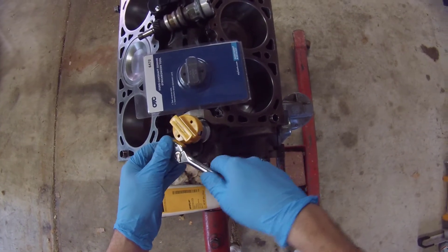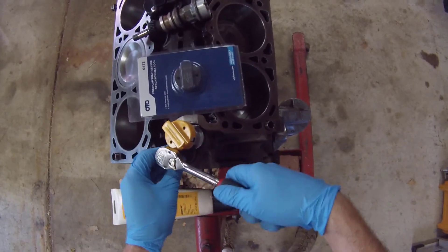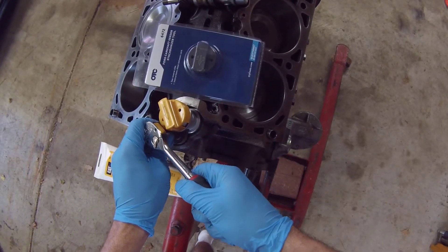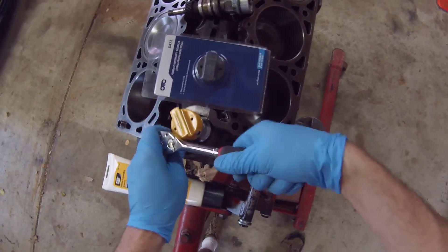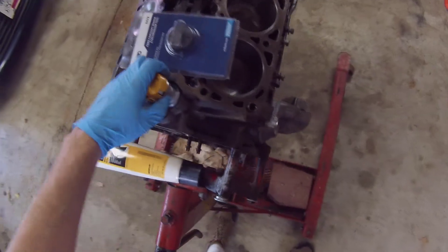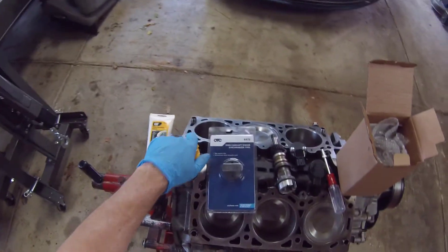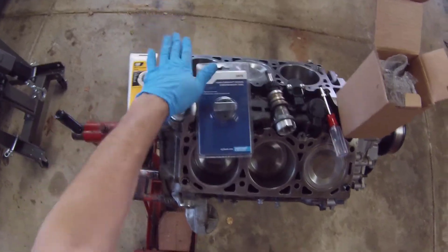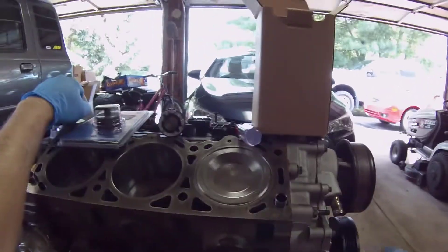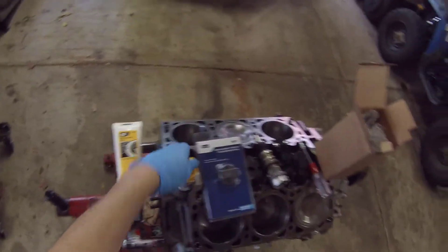The early three-wire is a little more tricky. The late three-wire is as easy as the two-wire. And that's tight. So: the alignment tool zeroed the synchronizer, zero timing mark on the crank — timed, timed, timed, and we're good. That's all you need this tool for.